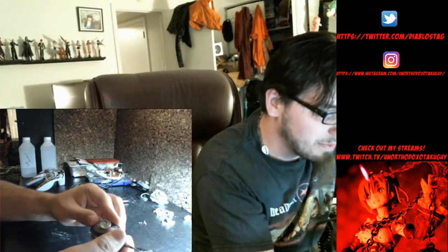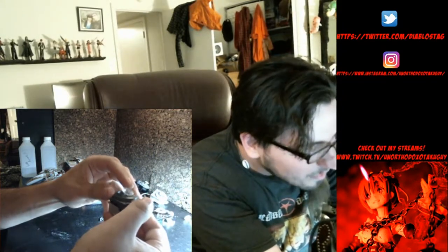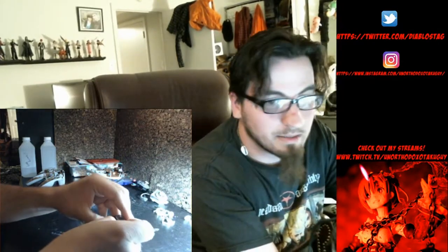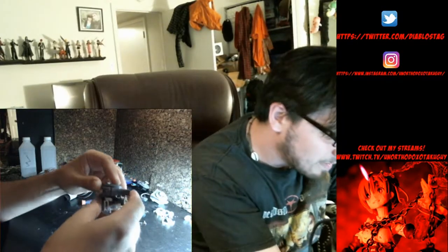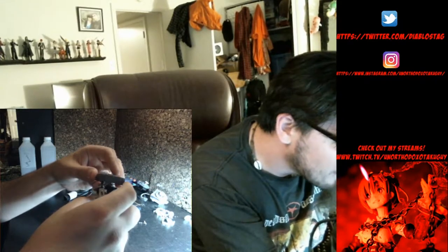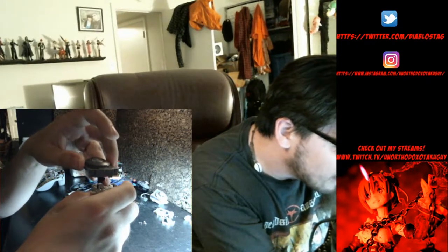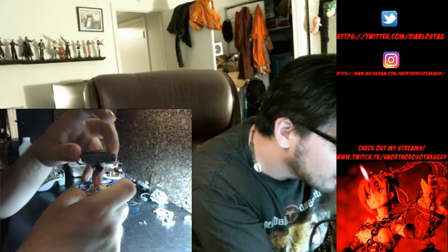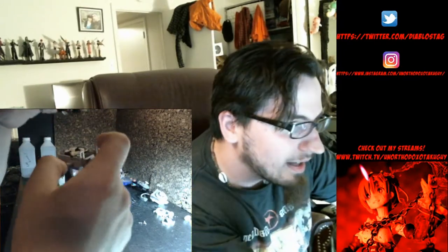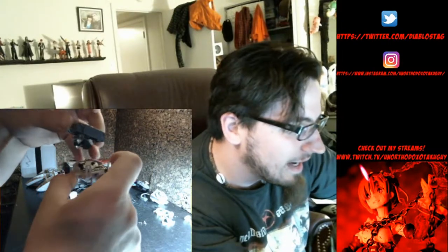You're going to feel the spring fight you, so what you want to do is just make sure it's level as much as possible. And we have some malfunction. That's why this is a little bit of trial and error when you're doing something mechanical. So we need to find out where the stick is moving. Try again. You want to drop it straight into the gear at the bottom. It has to line up, otherwise it won't work. That bottom part of the control stick has to drop in the cradle, that little slot right there, and has to drop in that gear.